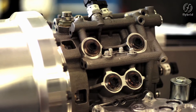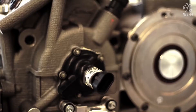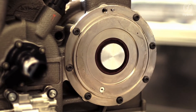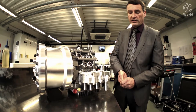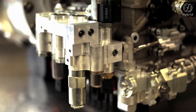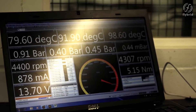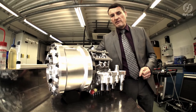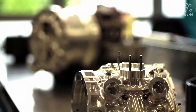The flywheel is connected to the vehicle via a transmission — specifically a CVT, a continuously variable transmission — which is connected to the car through output gearing and a clutch, with the output to the vehicle coming from the back side. On the front we have the control hydraulics, very similar to what you'd find on a modern automatic gearbox, using relatively low pressure. These allow us to smoothly control the amount of power either being stored or delivered back to the car. On the back of the system there is also a small electrically operated vacuum pump that tops up the vacuum inside the flywheel chamber as necessary.